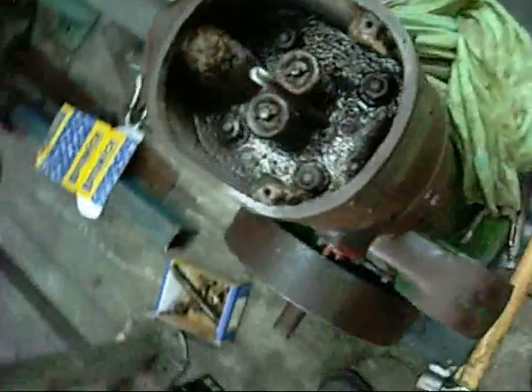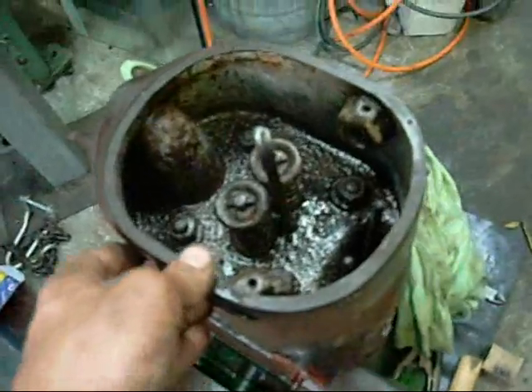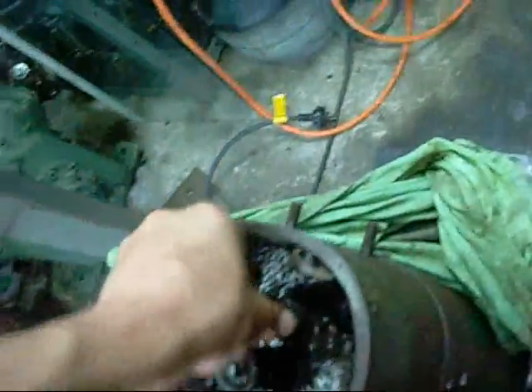About two hours later we get the rockers out. Everything is intact and usable. The valves I'll address after the head has been through an electrolysis tank — I'm going to use electrolysis fluid to actually break free the rust in the valves. That one moves, that one doesn't.